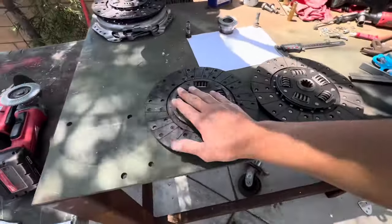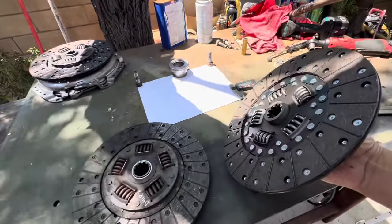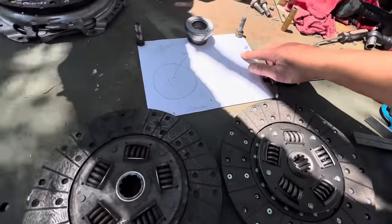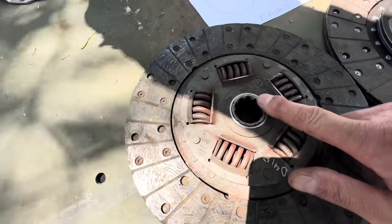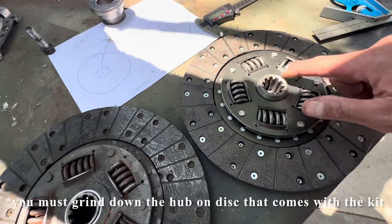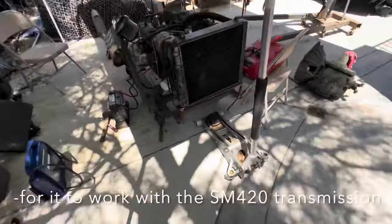These new post-COVID discs have a 7/32 inch hub — a little bit less than a quarter inch. The old pre-COVID discs have a flat hub measuring 11/64ths, just under 3/16. So what I did was grind the new disc hub down to 11/64ths to match the old disc profile. Put one of the ground discs in there, and kapow — it works. Combination confirmed.